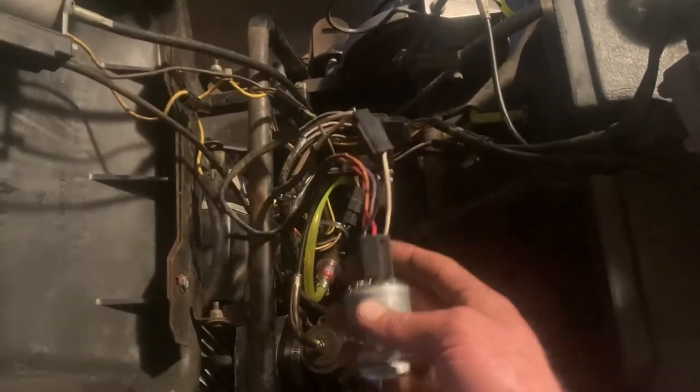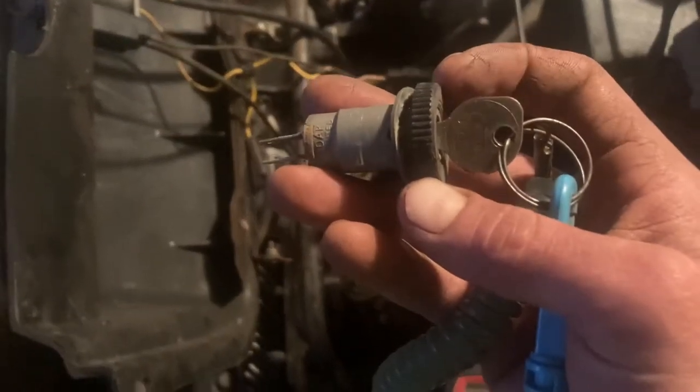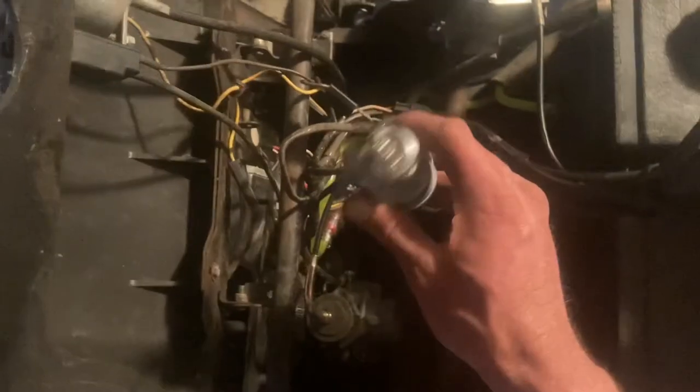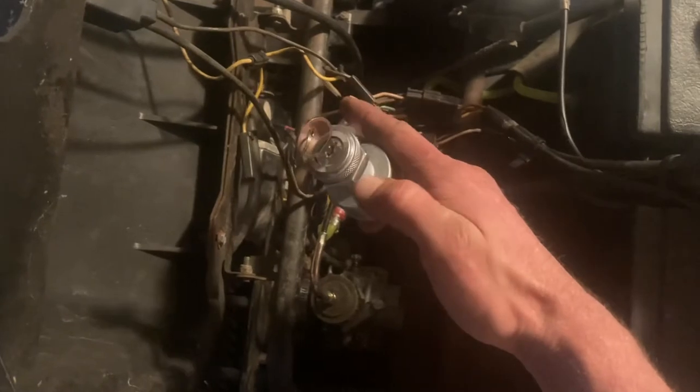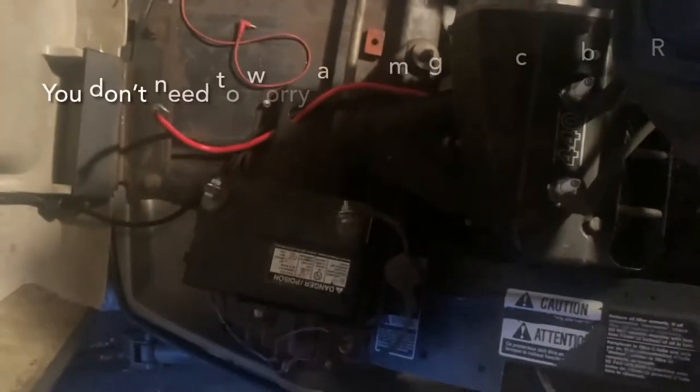Okay, we're back and it's the next day. I've taken and switched all of the connector wires around. I also put the key switch in — I took the old key switch out. This little collar screws off and then it falls out; you should have already unplugged that. You're going to have to take and file the hole out a little bit, because the diameter of this key chamber is a little bit bigger. Use a rat tail file just to get it to fit in there. That's pretty much it. Once you do that, you'll need to hook your battery up like I have here already.